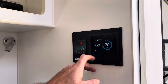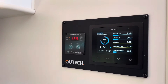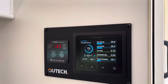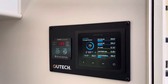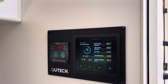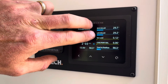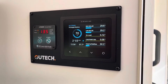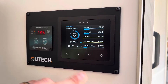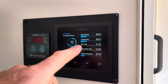As you can see, it's 9:29 in the morning on Friday the 1st of December — 30 amps per channel coming in from the sun. That will increase throughout the day, and it shows you how much solar you can capture early on with the right system installed. We've got our two solar strings, with this van divided left hand side and right hand side. We can look at total inflow and outflow, and I've got the inverter on at the moment so I'm going to switch the air conditioner on in a minute. We've got state of charge and our loads.